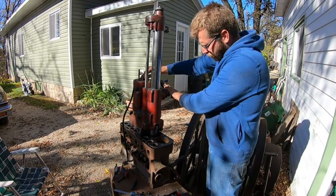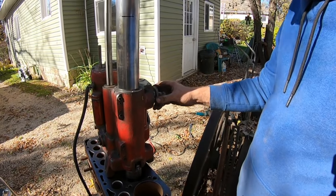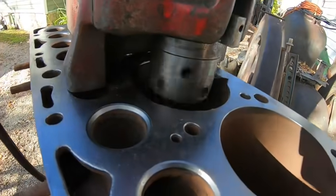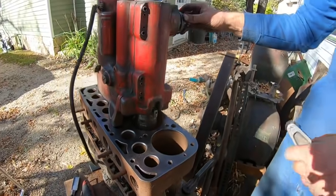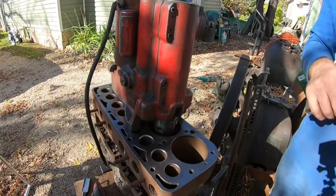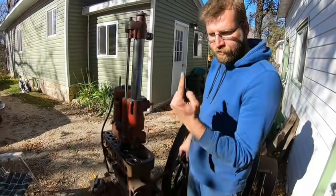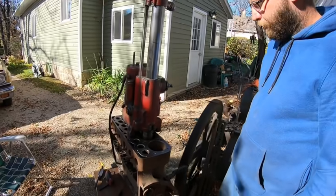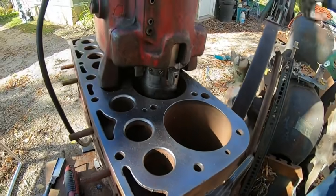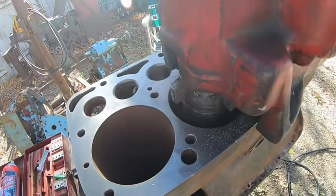It's been a while since I used this — I think I remember how to use this, so we'll fire it up. I think this guy's got it engaged. There it goes. It just went through where the ridge was — it's barely even cut it. That's how worn this is. I thought maybe the cutter slipped or something, no — it was so worn it went heavy, heavy and nothing came through. You can hear how it was centered on here and now you hear it's off to one side — I guess the piston had worn to one side. You can actually see the ridge — it didn't even clean the ridge up. That would be for a 30 thou overbore — you'd have to come at it from this side. That's how worn this engine was — the 30 thou overbore wouldn't have cleaned it up.